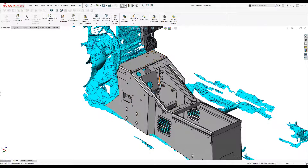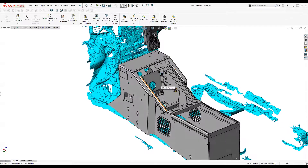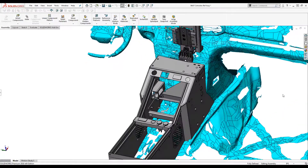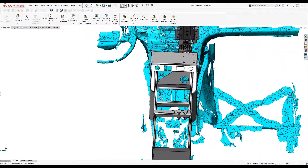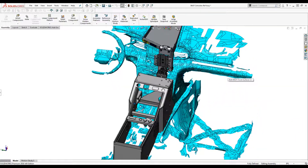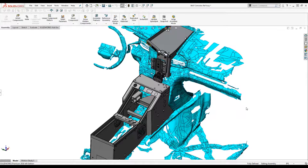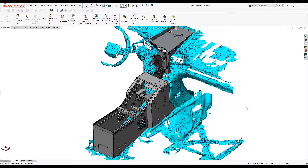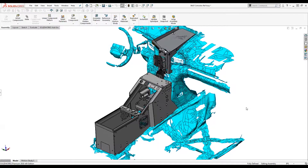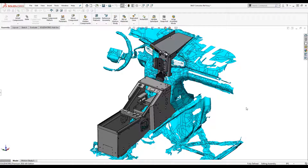For example, there's an electronic parking brake that this console covers up, so we relocate that onto the side. There are some USB and 12-volt outlets that we cover up, so we relocate these up here, making sure they have enough clearance to run wiring and that the wiring is long enough. We make sure it works with all of our products: reinforcements so you can mount a motion device to the top and it won't wiggle, a heavy-duty mount on the side so it won't move around, and clearance so it clears the bottom of something like a dash monitor mount. Once we have a design we're happy with, we prototype it — made on the same machines used for production parts.